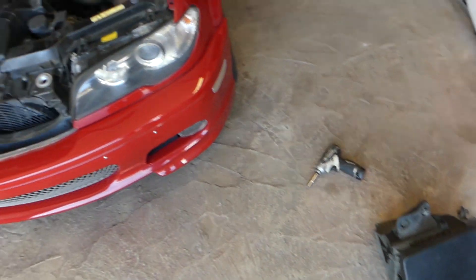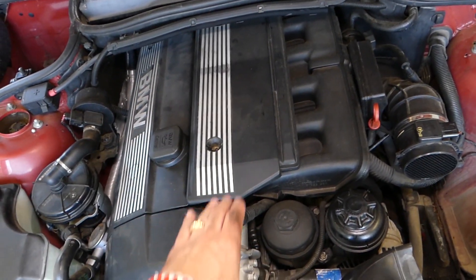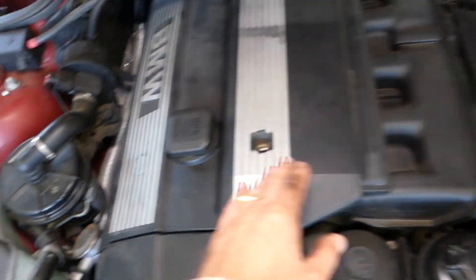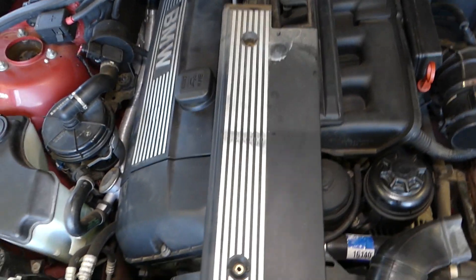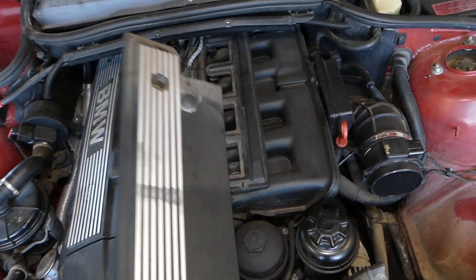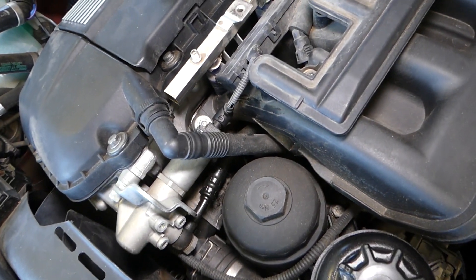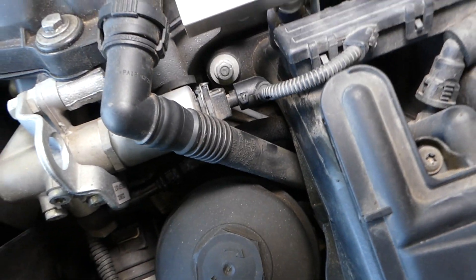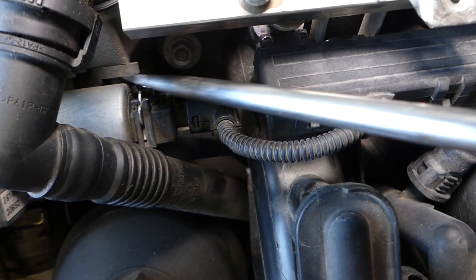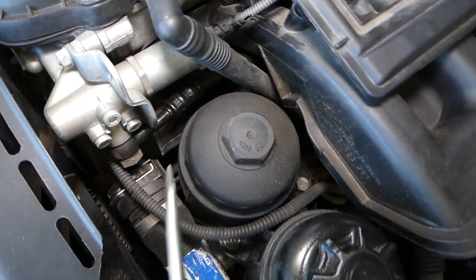We removed the intake box and I'll explain why in just a second. Now looking at the engine — on this side right here, this is your intake manifold; the exhaust manifold is on this side. I removed that cover already so I can show you where things are — you have two caps and two bolts. That camshaft position sensor for the intake camshaft is located behind the VANOS solenoid — that black thing right there — that's your sensor.